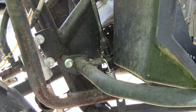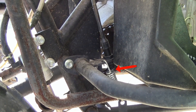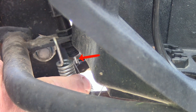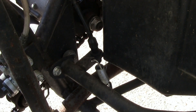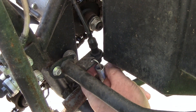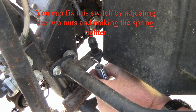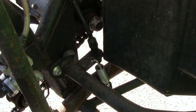Now I'm going to come down here and diagnose the brake switch — it's right here. If this isn't working, then you won't get any power at all. As you can see, when I press the brake down, it's not pulling that switch down. You'll see a little pin behind this spring — move that spring out of the way, you can see it right there. If that's not being pulled down by the spring behind it, then this isn't working. If I turn the key on and pull on this rod out from that switch, the bike turns over — so this switch is the problem. I'm going to have to either fix it, adjust it, or replace it.